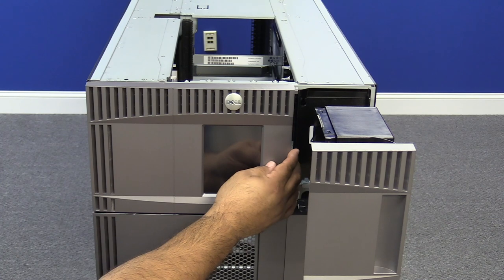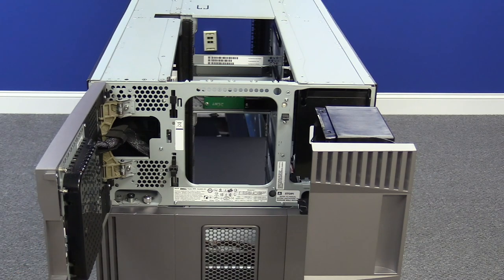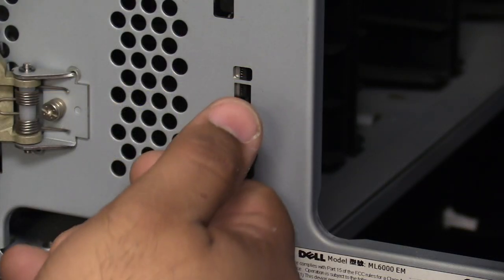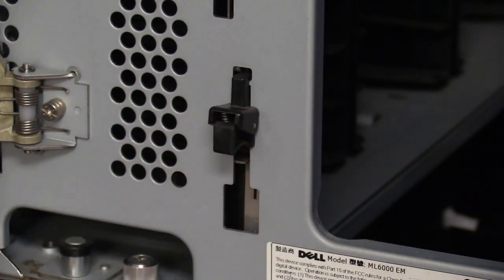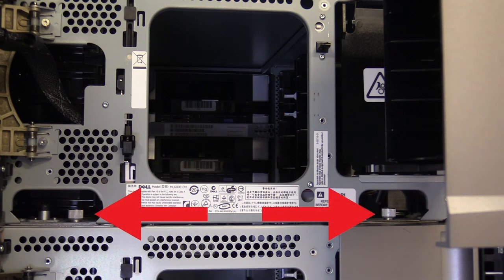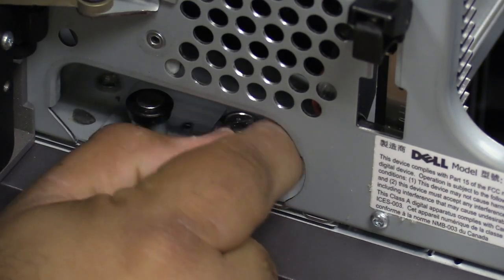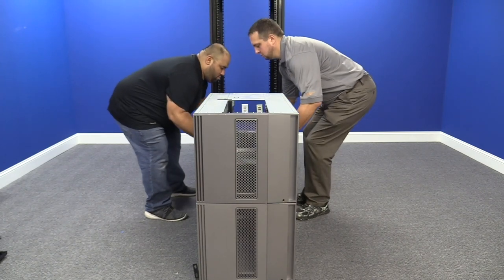You are now ready to move to the front of the library. In order to access the picker tracks in the front of the control unit, you will need to open the main access door if you have not already done so. You will see the same type of black squeeze clip to the left of the main opening in the front of the control unit. Using the same method as before, raise the track so that it is locked in place. Now undo the thumb screws holding the front of the control unit to the expansion below it — located at the bottom of the control unit below the main opening, accessible only while the main access door is open. Undo both thumb screws. Once this is complete, you will be able to remove the control unit from the expansions below it. Lift the control unit off the expansions and put it to the side out of your way.